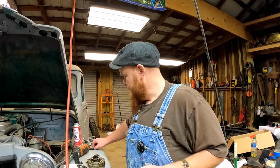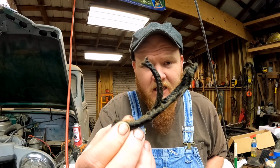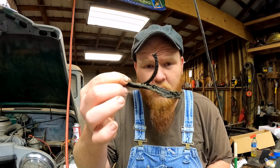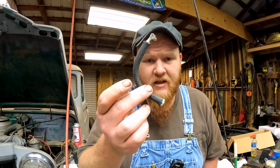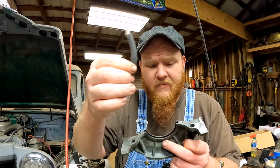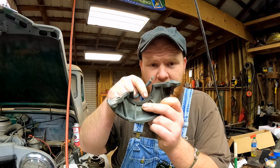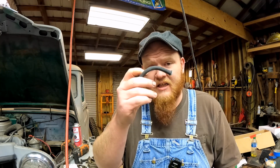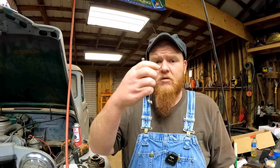This truck, this is a 1960, it had a rope rear main seal. This is what's left of it. Now, interestingly enough, this rear main seal didn't appear to be leaking very much. It was leaking because you could see it on the ring gear and stuff, but it wasn't insane. But that's what's left of it. And this fit into this groove, and it's a horrible idea. Trash. This is the new rear main seal, and this is also trash, because you've got to jam this into this tiny groove. You've got to try to fight it in there. This part is actually feasible. You could probably do it on this side. But on the other side, this is inside the engine block, and you've got to try to push this rope, it's literally rope, out, be able to grab it, and pull it out.